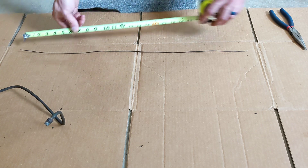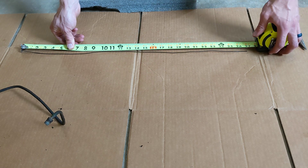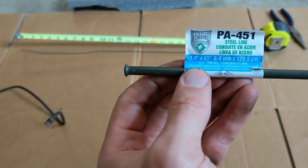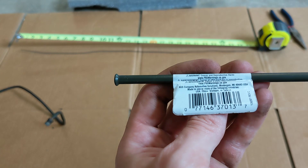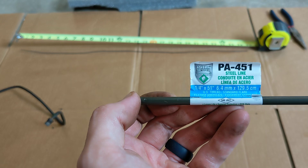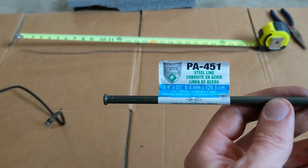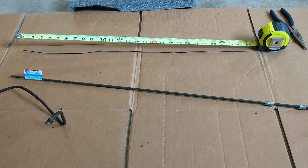That measured out 27 inches. The piece of line I bought — you can pick these up anywhere, I'll put a link below, I'm sure Amazon has them — this is a quarter-inch US thread standard flare line, the poly armor green ones. You can just use regular steel if you need to. 51 inches was all they had on the shelf, so I went ahead and got that — I think it was about 10 bucks. We're going to cut this a little bit longer than 27 inches, so I'm going to go ahead and cut this at 28 inches.